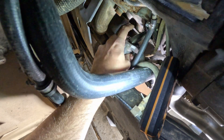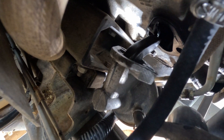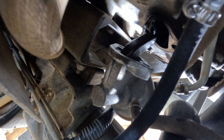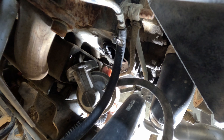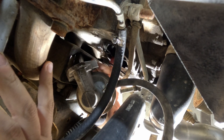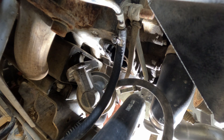I get the old gasket off - there we go, I got the pump out. You can see the four-hole cover plate; I've got to get that out next. The lower bolts are nice and easy to take off from underneath - a box end wrench is sufficient to get them, then just grab the plate and it comes free.